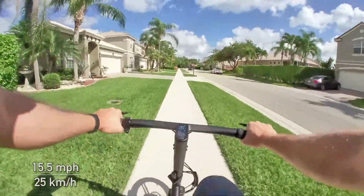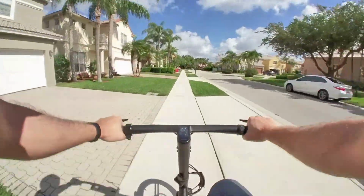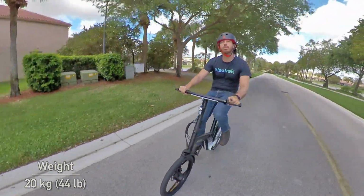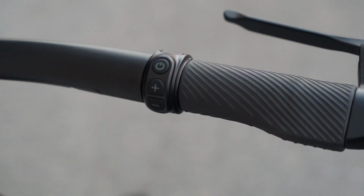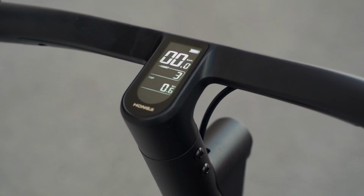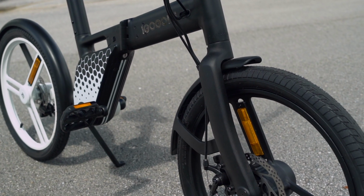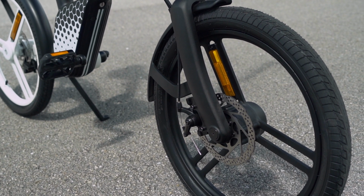It's only got a 15.5 mile/hour top speed, but it's also a single-speed e-bike, so you're not going to be pedaling it that fast anyways. This is an easygoing, lightweight e-bike that is designed for cruising around at modest speeds in a city or suburban setting. There are 5 levels of pedal assist, though no throttle, and so you do get to choose from a decently wide range of assist levels. But again, this is not a high-performance bike. They put their resources into style points when they designed this bike, not percentage points.